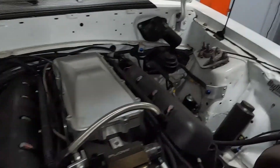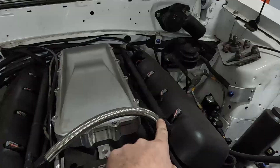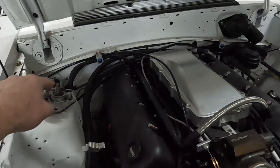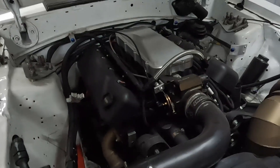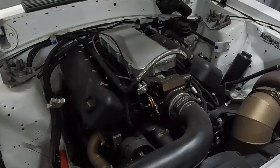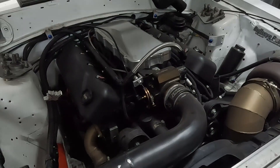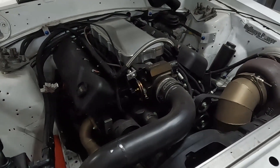Up at the front of the car we have this fuel rail which gets fed by the dash-8 line that goes to the back of the car. We've got a jumper across here, we've got another fuel rail, and that all exits into the fuel pressure regulator. Now I'm running Bosch 210 injectors which have been absolutely fantastic. I pickle them with pump gas over the winter — what I do is drain all the E85 out of the car, fill it up with 94-octane pump gas, run the car on it for 10 minutes just to make sure all the ethanol is out of the system, and store it that way. It worked perfect last year and fingers crossed it works perfect again this year.